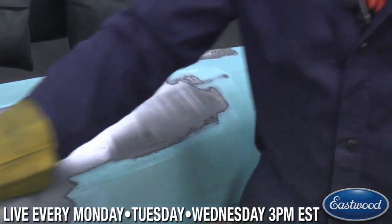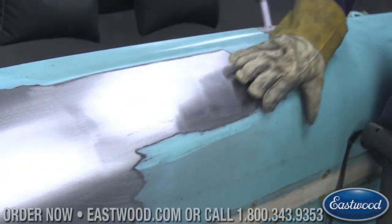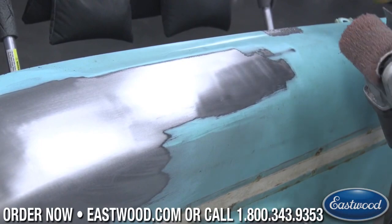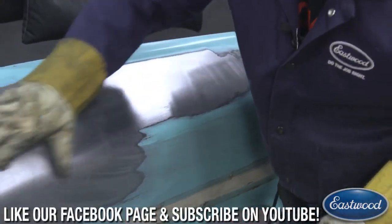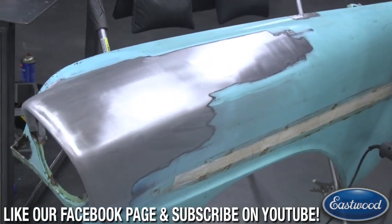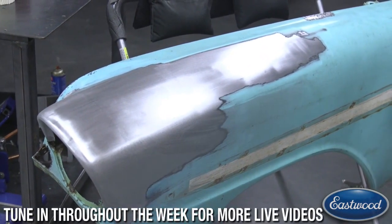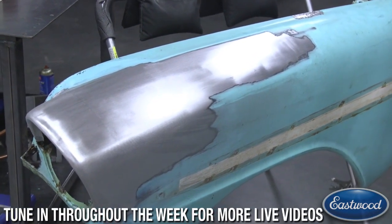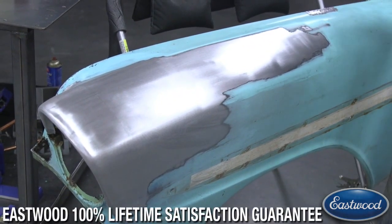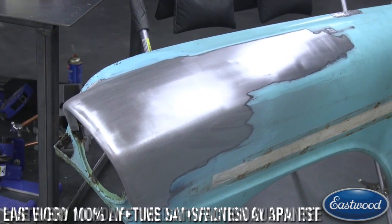Wow. I wanted to show you guys that even though we say the black drum is best, you can use the red drum — you just have to push a little harder and it wears out a little quicker. But I'm taking off lacquer paint even with this finishing drum because the tool has so much power to rip through it. And if you look at that finish — that's a beautiful brushed finish. If you send that to your body guy to prime and do his final painting, he's going to be very happy. If you want the quickest solution: take the black drum, knock it all down really fast, then swap to your red and run back over the panel.